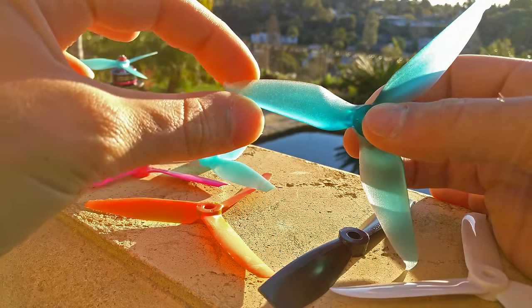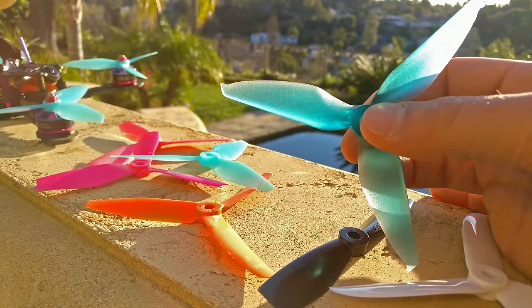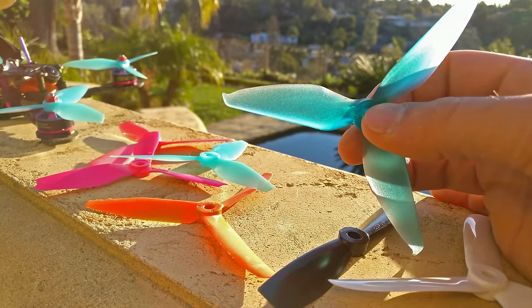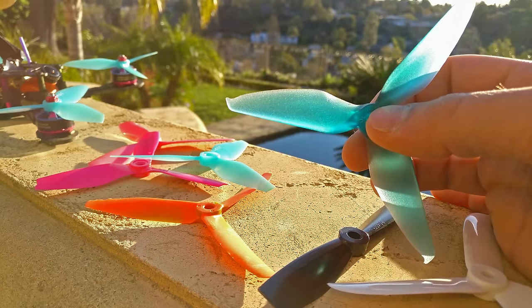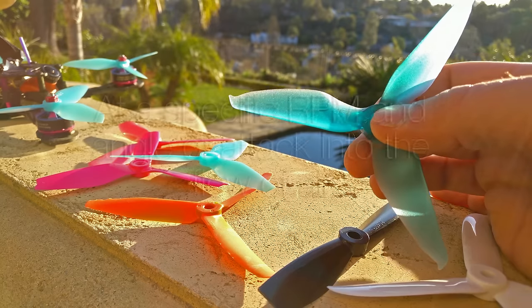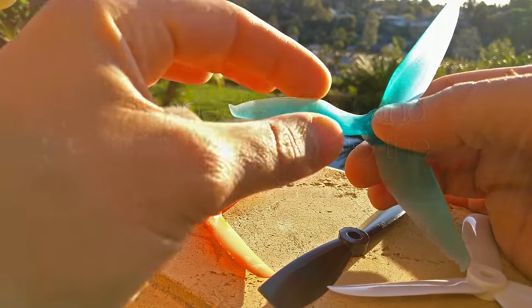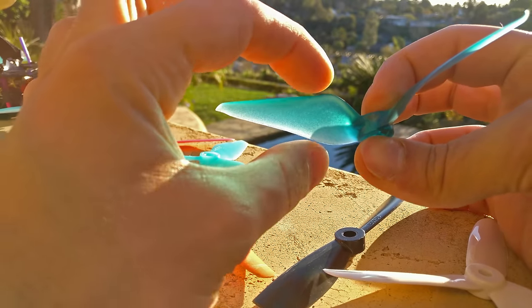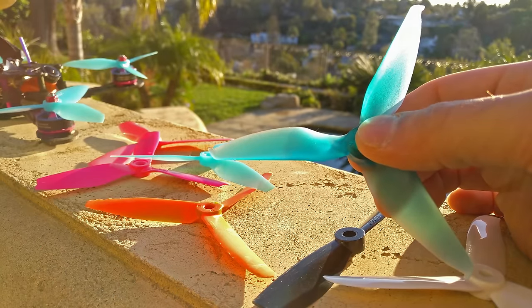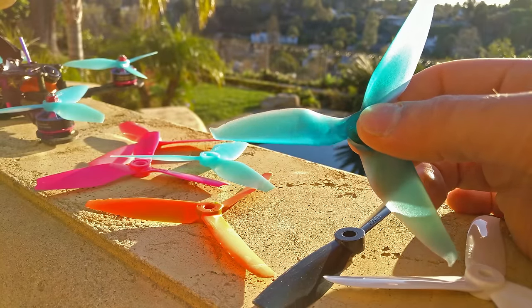As I trail down the blade, it has a very specific kind of shape, and I'm guessing it's been engineered to be most efficient at a particular speed. This is before I talked to the designer. It has in fact been engineered to a speed of about 60 miles per hour. What that means to me is that at the spin rate required to achieve around 60 mph, the majority of the blade is working all at the same time — this aggressive big meaty scoop takes effect at that RPM, and the whole blade throughout its taper is probably making relatively even thrust. The prop will be very efficient when the whole thing is working together.